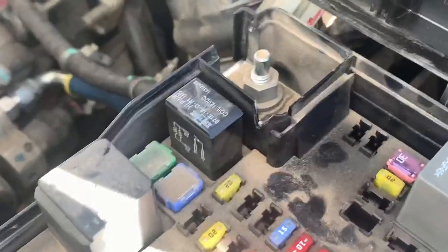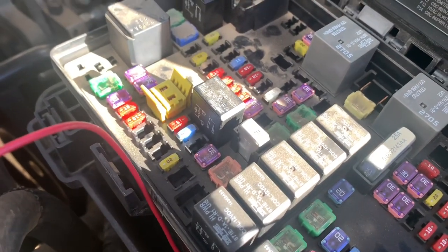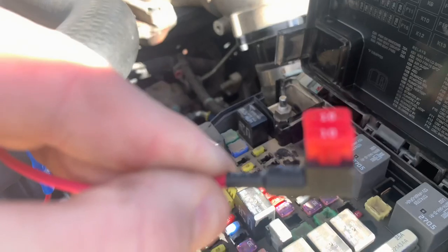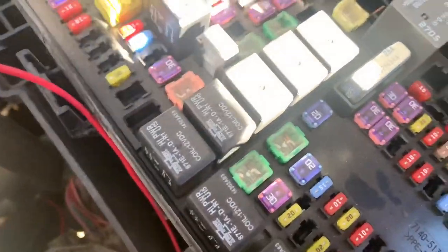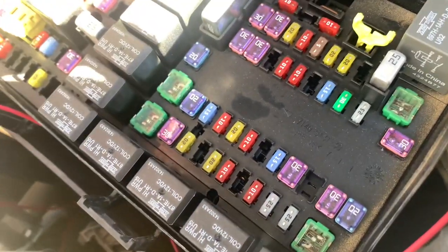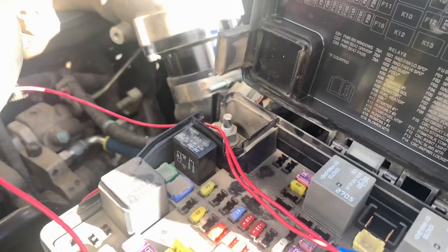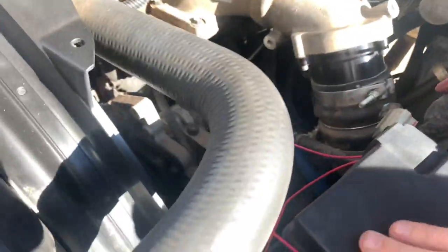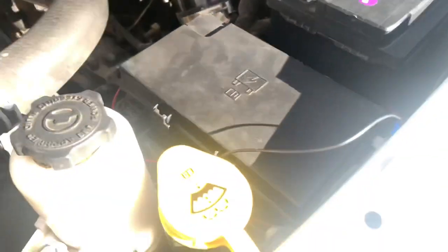With the fuse tap, you notch a little spot in the fuse box and run the wires through, then find a fuse you can tap off of. You pull a fuse out, plug the prongs in like a fuse, and then you've got two fuses off of it — so if you're using a 10-amp fuse tap, just pull a 10-amp fuse out. The one I used is for the backup camera. You can see the fuse tap seated in there and the wires going out without getting pinched by the fuse box cover when you latch it down. Tuck your wires out of the way so they don't get caught in anything.